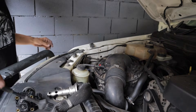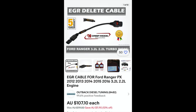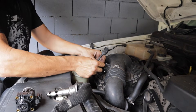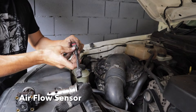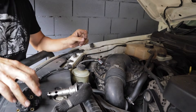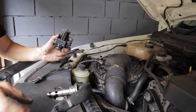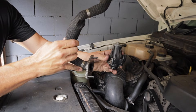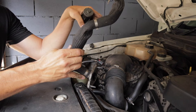So how do you stop this from happening? The easiest and simplest way is to buy yourself an EGR delete cable. This one isn't from an actual Ranger — it's one I had laying around — but how it works is it plugs into your plug here that goes to the airflow meter. You plug it into one end and then into your airflow meter, and what it does is trick the signal to the EGR valve and keep it closed at all times, preventing any exhaust gases from flowing up into the intake manifold.